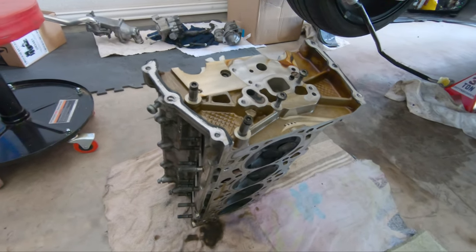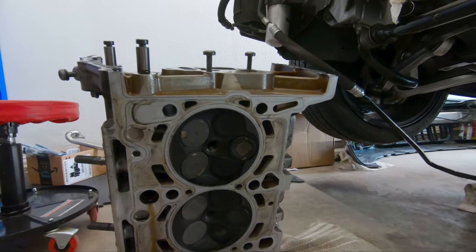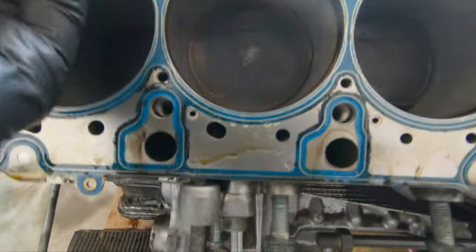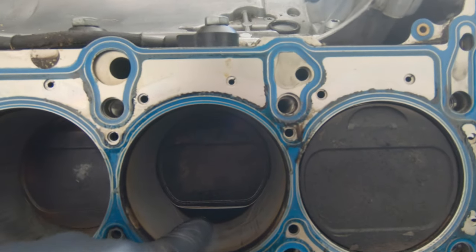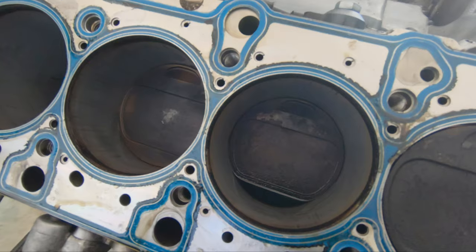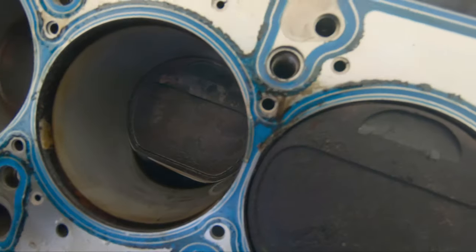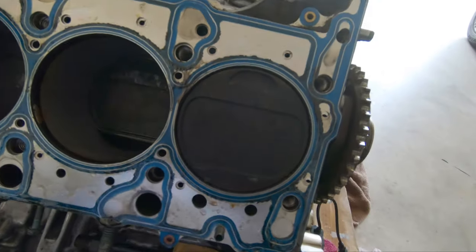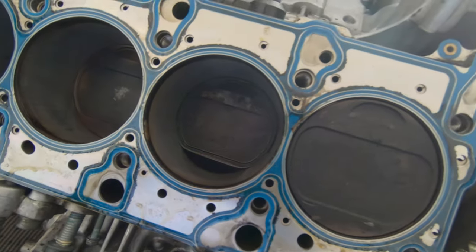Here is the driver's side of the heads. Looking down below, these two valves are your exhaust and these two are your intake. Cylinder four looks pretty normal. Cylinder five, same thing. There is a puddle of oil here — I don't know if that was due to the hydrolock. It is oil, not water, though there may be a thin layer of water. There are some scores around the cylinder walls. I'm not sure if this oil leaked when I removed the head.